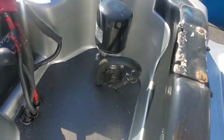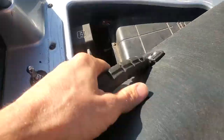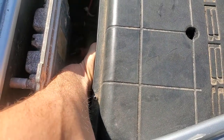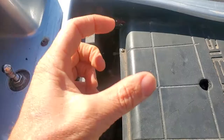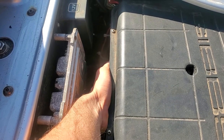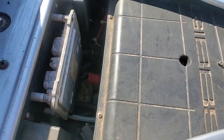To pump the oil out, you can just remove the seat and reach that point right under there — that tube. You just have to feel for the bottom until you feel that plastic part that comes down, and then you just pull the rubber hose off, angle it back, and slide your vacuum pump in there.